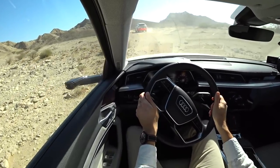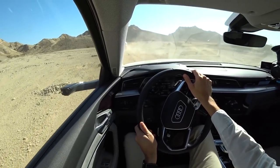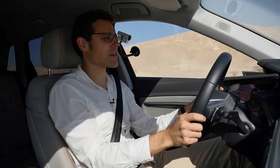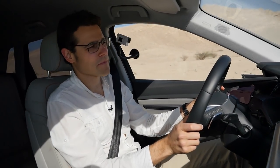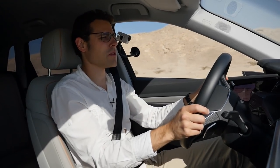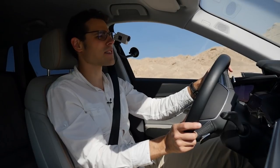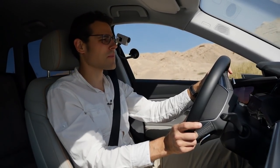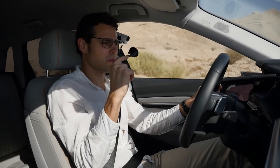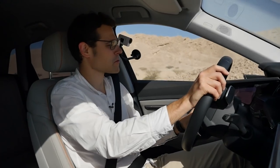The overall ground clearance is about 17 centimeters. Again, you can lift it up a little bit higher, but this car does not have premium ground clearance. So it's not for hard off-road use and for really steep inclines and so on. You see, even here, I have to go rather slow so I don't scratch the ground. Hill descent control, even in this short part, was already activated. The car is doing that by itself automatically.